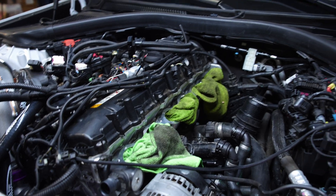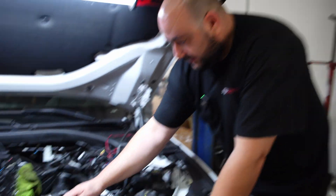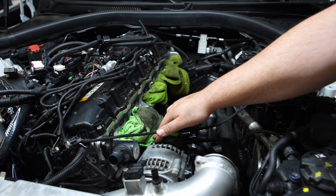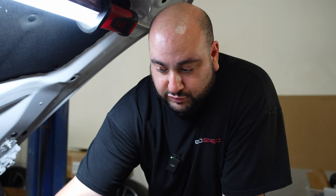We just got the lift plate installed — it's called the lift plate because it brings this big manifold up so it can clear the alternator on active hybrid systems for the 2023, 2024, and up. The alternator is about two times the size of this. A regular port injection spacer will not work — it hits the alternator. So anyone wanting to do port injection on a Gen 2 with the active hybrid will need to go with an intake manifold setup like this one.